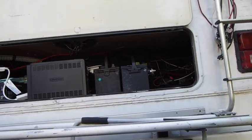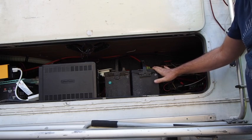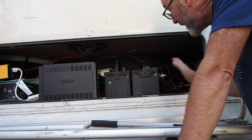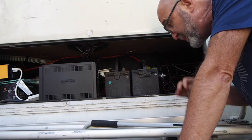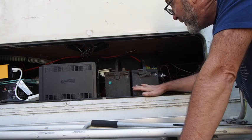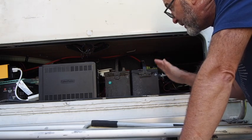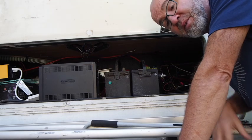Now if you know anything about wiring batteries for a solar power bank, you'll know that these are an offshoot — all the batteries are wired together positive, negative, positive, negative into one giant bank, and these are just attached onto it, so they're not wired the same way the rest of the bank is. That's true, but I've been using this system for about six months, monitoring and testing it, and it works just fine. It's not optimal, but I'm not going for optimal — I'm going for keeping these batteries healthy and putting them to good use when I'm parked. It gives me extra power when stationary and keeps the batteries charged when I'm not running the engine for long periods, and it works a treat.